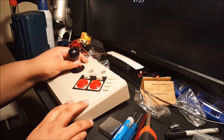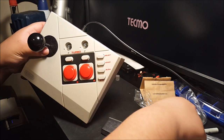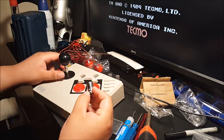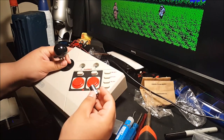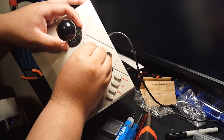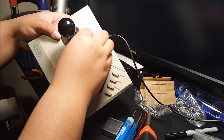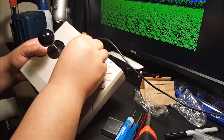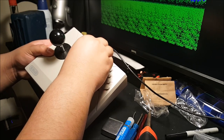Second thing is right in there, there's two bolts, or nuts, not bolts, two nuts. They are a 10 millimeter. So they're not on tight or anything like that. They're like on hand tight, basically. So, I mean, you just place it in there. You don't even need a deep, deep socket. Get in there and unscrew it. The reason why you need to take those out is because those knobs are soldered to the board. So just another place to take apart the board inside.